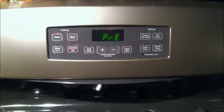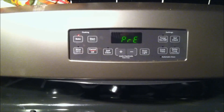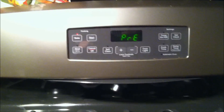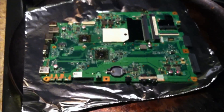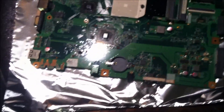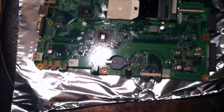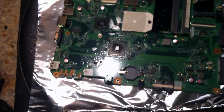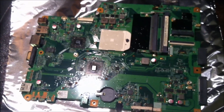Now that your 10 minutes is up, I'm going to repeat to you several times: do not touch the motherboard — let it cool. It just came out of the oven and it's going to be hot. Don't move anything, don't do anything. Let it cool down for at least 20 minutes to half an hour, just like you were letting a pizza cool. You can watch the little aluminum foil move and all that. Let it cool.